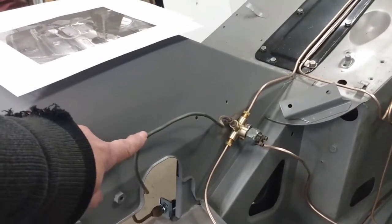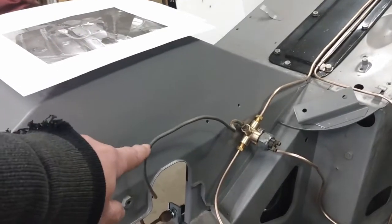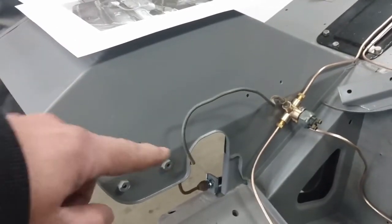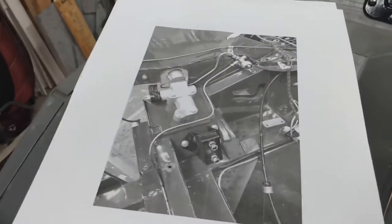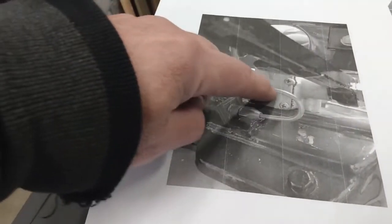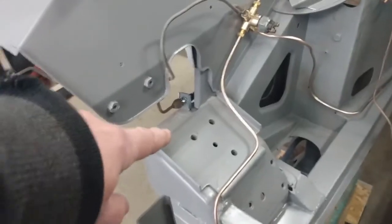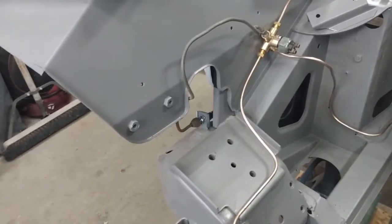This is how mine was configured in the car, but I wasn't confident that it was the correct way of doing it. Several people sent me photos of how that pipe is routed on their car. It goes under the damper and when it comes through the other side it comes in front of the damper and then makes a tight bend into that. So I'm going to install the front damper in the correct position here to make sure I don't get interference on that.